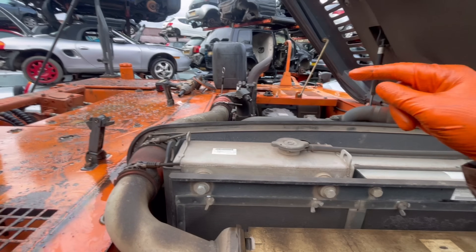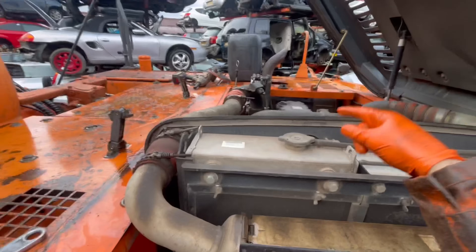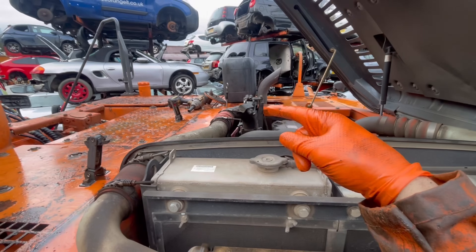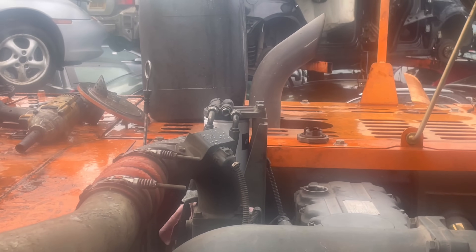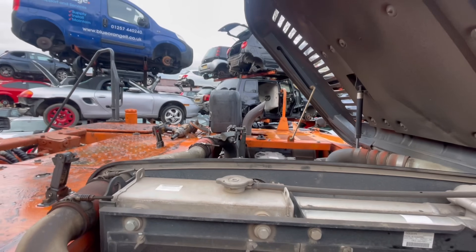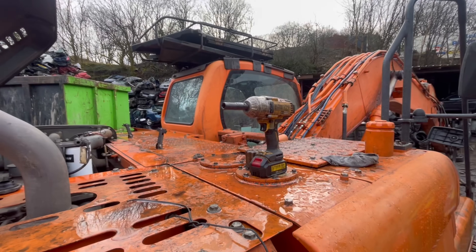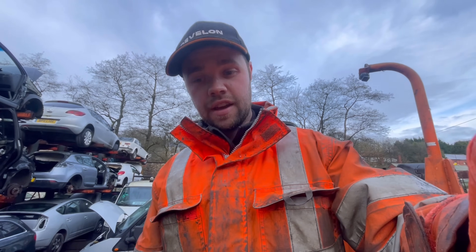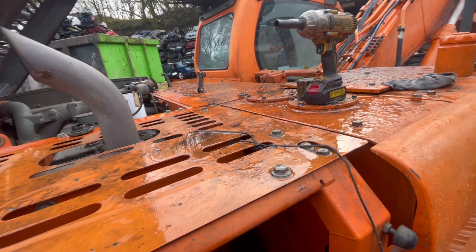I've got this filter bled up no bother. Now I've got to pump it all the way through to the engine — the fuel pump has a mechanical lift pump, so once started it draws all the fuel through. It goes from here through the mechanical lift pump, then pushes it through that main filter. I'm standing here pumping away, looking until I can see fuel running out of that fitting. I think I've filled that filter. I'm going to put money on it — it won't fire off the key first time. I'll probably crank it a bit, pump the hand primer, crank a bit more.